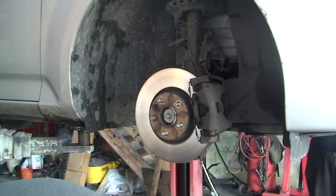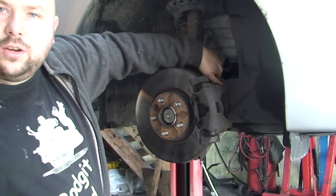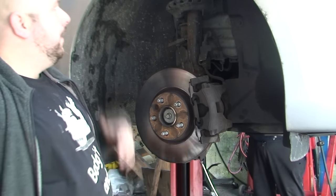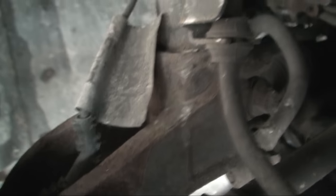The way to take it off is quite simple. We have to disconnect the drop link, which is here - one bolt on the shock - there's a bolt going through the shock, and we're going to take off the bottom ball joint. Once we've taken all them off, there are three bolts on the top and then the whole shock unit will come out. This is the drop link bolt here we need to disconnect, and down in here is the bolt for the shock, then underneath we have the ball joint.